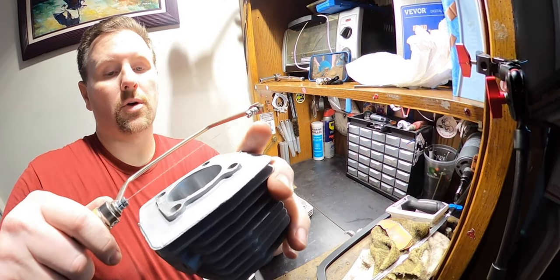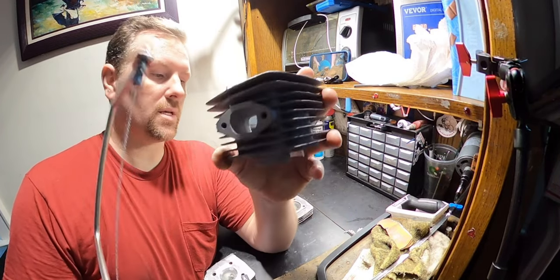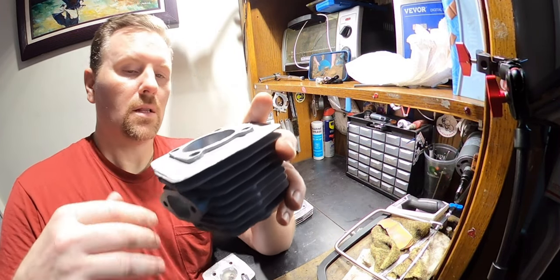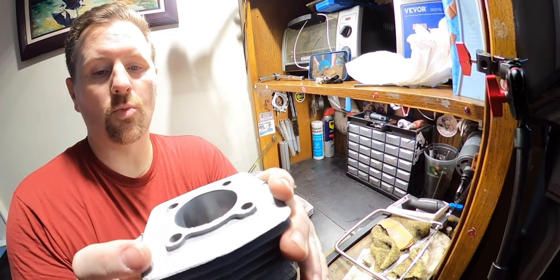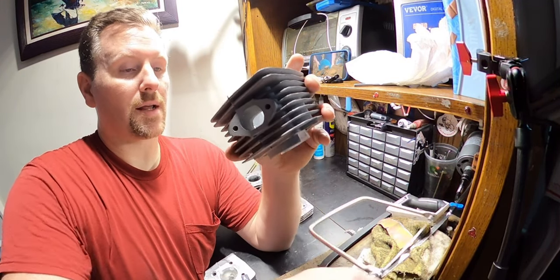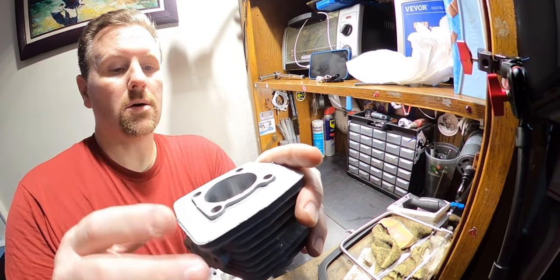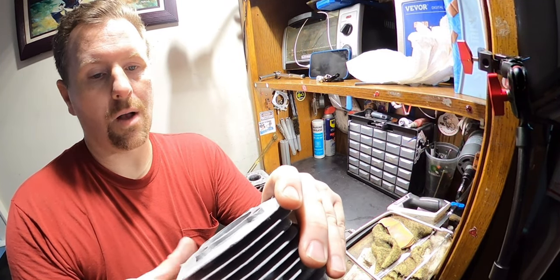Actually used a scroll saw. It had a much more aggressive tooth, and it also was extremely thin. It doesn't have waviness like a hacksaw does, so I was able to be much more precise with that, and I actually liked cutting it a lot more. The biggest drag that I had is the draw I have is very minimal. It took longer, but I was able to do a much higher quality cut.